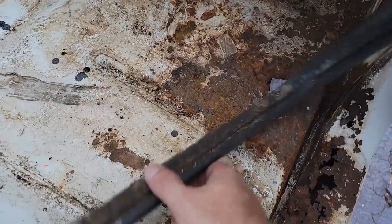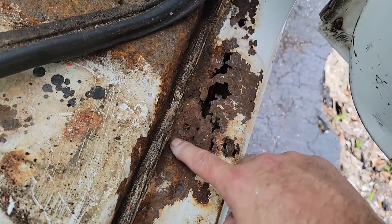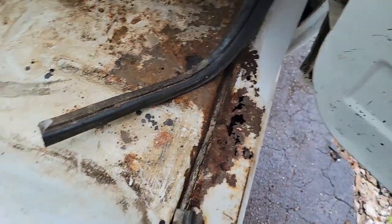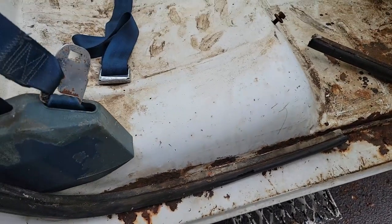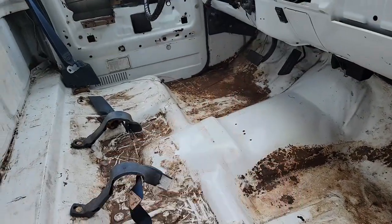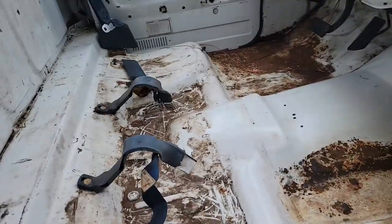This side is a little worse than I thought, but it's still doable. I can still cut this along the pinch weld and just patch that in — probably from here to here, pretty flat piece. Same thing here — patch that in. I don't think it's worth doing a whole rocker for it; I can just patch those through. So I've got one, two, three patches and then that spot over there. The rest of this floor is pretty solid — I'll rust convert it and then prime the rusty spots.